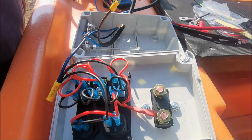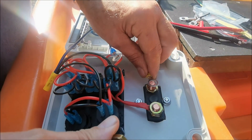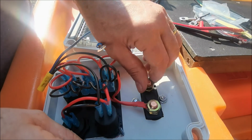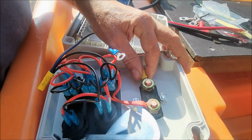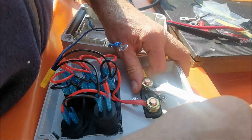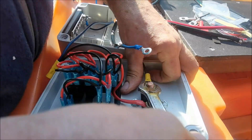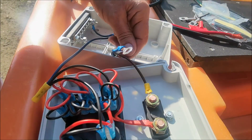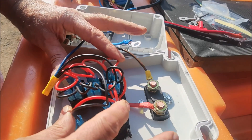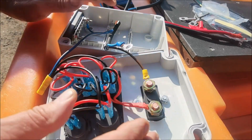Okay, so now we've got this wire coming in here, coming directly from the battery. We're going to connect the live to the bottom of the isolation switch. So: live from the battery coming in to the bottom of the isolation switch, from the isolation switch coming out going to the live on both sets of live wires on the switches — so it makes all of these live, including the little LEDs which are just for show.